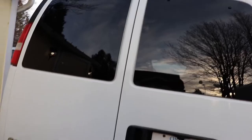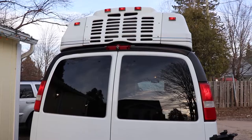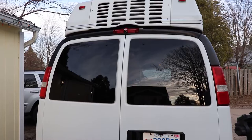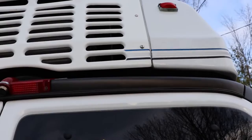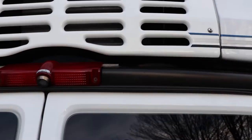For some of these lights you can just use the remote control — hit unlock and see if they work. For the brake lights and reverse lights you'll need someone to help you, or if you're near a big window you can put it in reverse and see your reflection. These vehicles have problems with the body control modules and can't always turn on the lights. Then check your license plate light, check that this cover is on and not loose, and also check the trough around the air conditioner with your ladder to make sure it's cleared out.